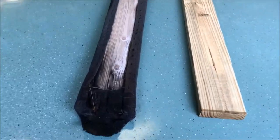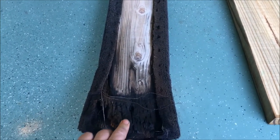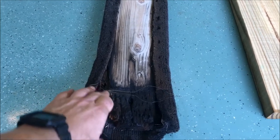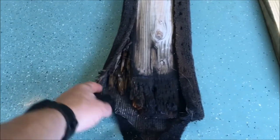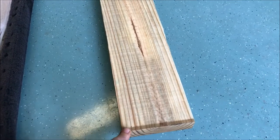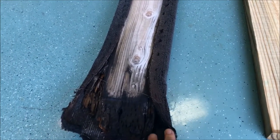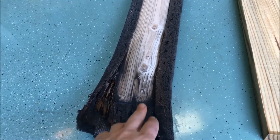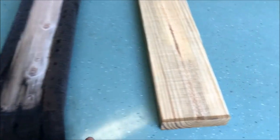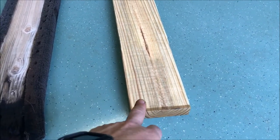To show you how bad this can get, here's the existing bunk board — you can see it is absolutely rotting off. I didn't even know until I took the boat off the trailer. The boat is maintained in the garage for the winter, so I don't know how it got so rotten. I'm going to replace it. Here's a new piece of treated lumber from Lowe's — it came in a 6x2 by 12 feet and I'll cut it down to a ten-and-a-half foot length. I've ordered bunk board carpeting, some good quality carpeting from Amazon — I'll put the link below in case you want to do this yourself. It's rather simple.